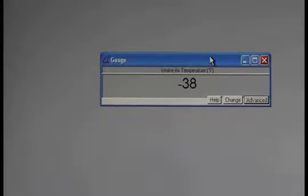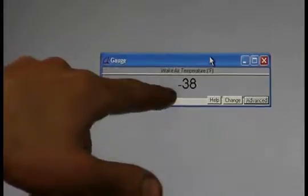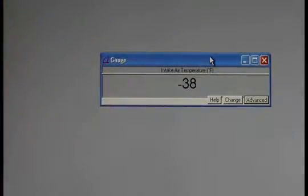All right, I couldn't actually show the trouble codes because I forgot I disconnected the battery when I was doing some other work on the car, so the trouble codes are gone. But again, it was a P0111 and P0113. What we can see is the intake air temperature sensor is reading minus 38 degrees, and it is not minus 38 degrees. The way the IAT works, there's a 5-volt reference signal. The IAT is a thermistor, and I'll explain all this at the end of the video.